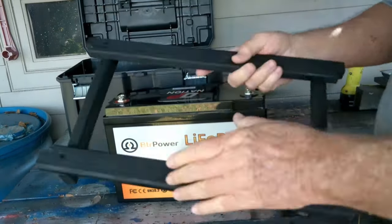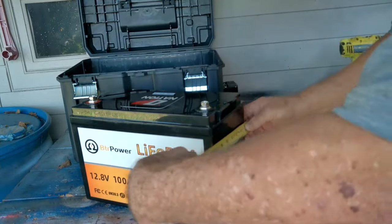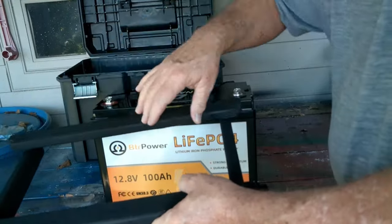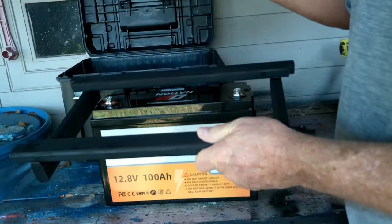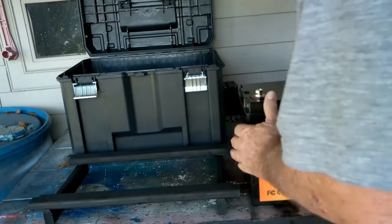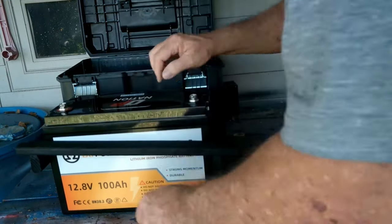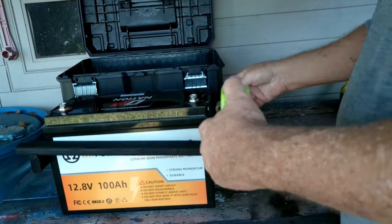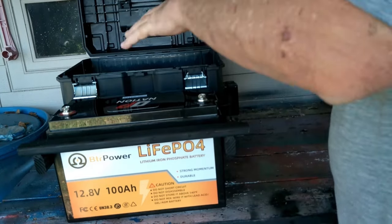So we're going to measure the battery this way — how wide is it? Not how long, but how wide. Seven and a half it says. So we have to make this bracket 16 inches across to fit inside these walls, and then six and a half this way so your battery can sit down in it. Most batteries have a little lip around the top. You want to measure how wide it is right under that lip — that says six and a half, not seven and a half. When you pull it up, it should fit tight and stay in place, just like that.